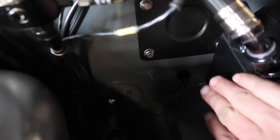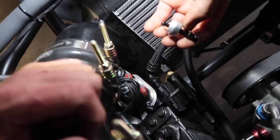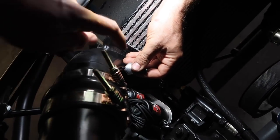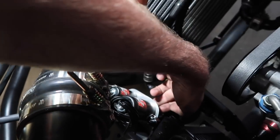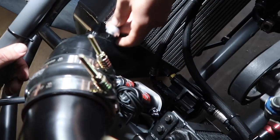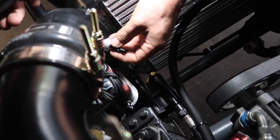Been plumbing back there — knocked a hole through the firewall. Me and Joe were talking about placement for the jet, and we're thinking right here. If he puts it there, it's drilled and welded in, but it's sunk in so it gives us room to get the fitting off. It's fed from underneath, so it's going to be like a short run of about nine inches. We might have to put it more up here just because of how far this is going to stick out.